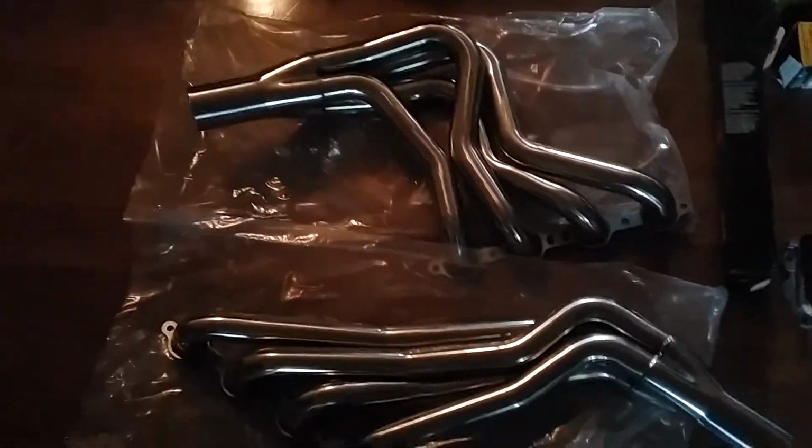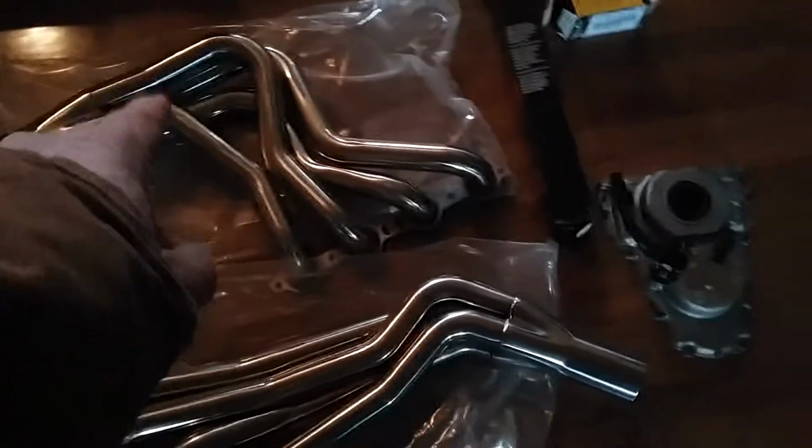They're fantastic. The only issue that I had was with this header in the 1 3/4 size. If you look straight down that pipe on the 1 3/4, they have this kicked up. So I had to slice it this way and take a wedge out and re-weld it to get it off the floorboards. But I took a chance on them again, and this one doesn't look like it's angled up quite so much as the other one, so I think these are going to work out great. They're cheap. I'm sorry, they're inexpensive. And I'm just happy as a pig in poo that I got them.